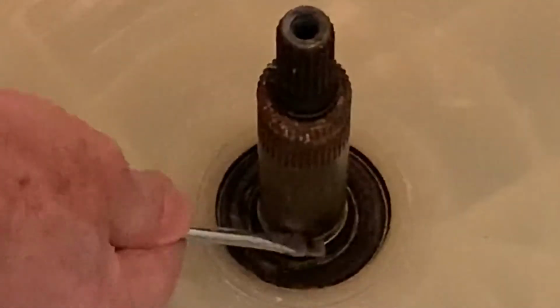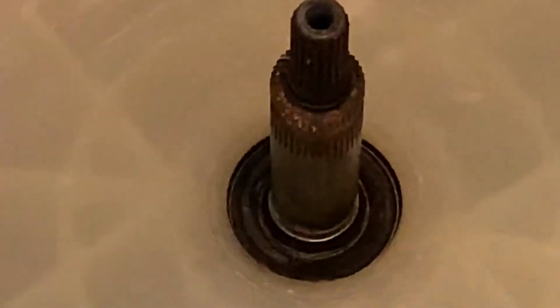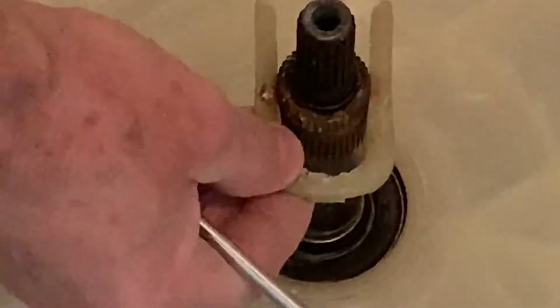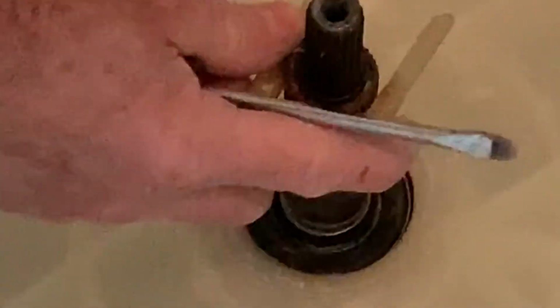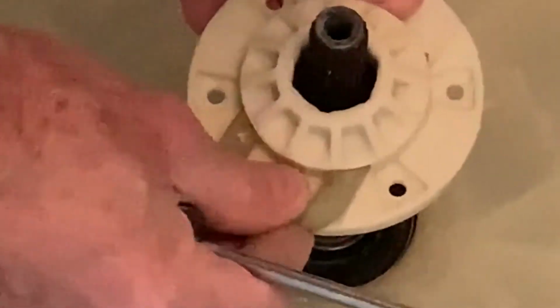This is the drive shaft, outer drive shaft that comes up, and there's a groove right here. And that's where the horseshoe clamp, when it goes through the drive body, sits in that groove right there. So again, remember I talked about we're going to put this on the shaft, and then the horseshoe clamp, at the right elevation, is going to sit on the shaft like this. That's what's going to hold the spinning basket, and this screws into the spinning basket, and that's what holds the spinning basket at the right angle, at the right height.